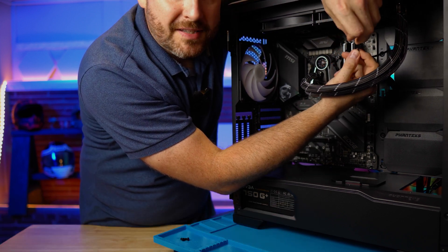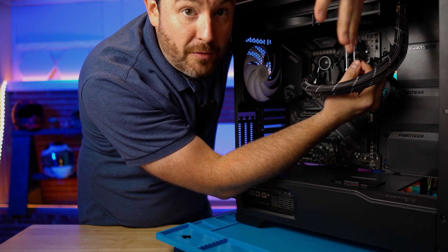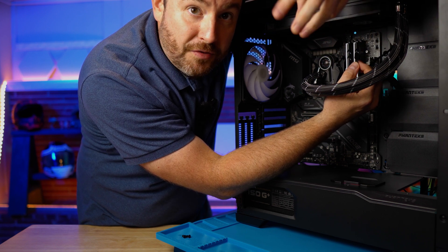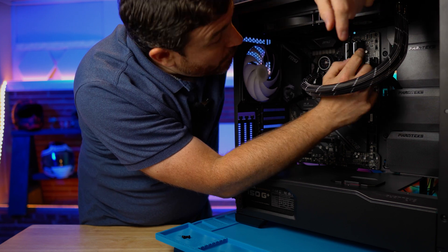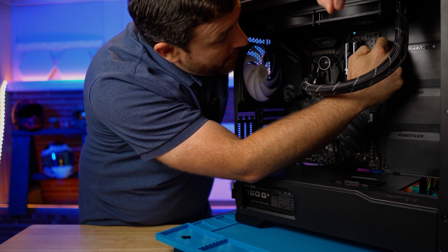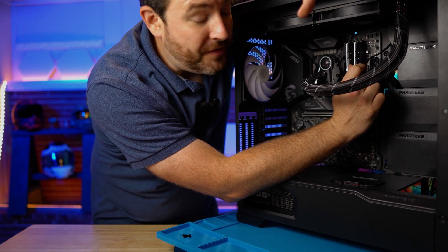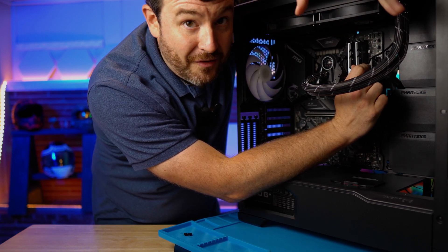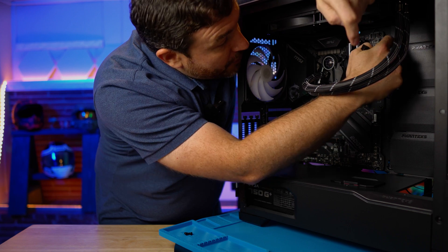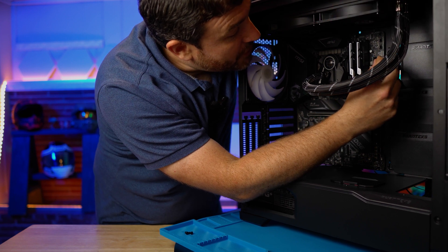This is a four wire cable assembly. Four wires means I have the ability to control the fan speed itself. Three wires means you do not. You'll also note those grooves — there are also pieces of plastic on the fan headers themselves, which makes it super easy to tell that it's a fan header. If it doesn't have those grooves, it's not a fan header. So we're going to orient this the right way — the little plastic tab goes in between those grooves, you give it a little bit of a push, and then everything is good to go.